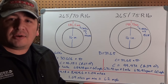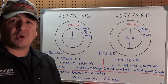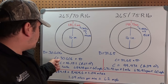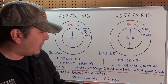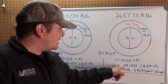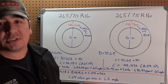Let's break it down and figure out how much that's going to throw us off — and by that, I mean it's going to cause the speedometer to be inaccurate, because the vehicle does not know how far it's actually traveling per revolution of the tire. The circumference of the correct tire is 30.606 times pi, and the circumference of the actual tire is 31.65 times pi. That gives us a circumference of 96.151 inches, or 8.01 feet, for the correct tire, and 99.431 inches, or 8.29 feet, for the actual tire — the distance each wheel travels in one full revolution.